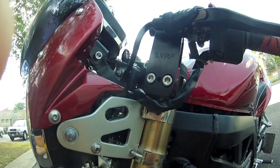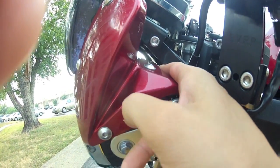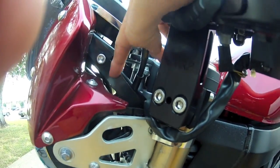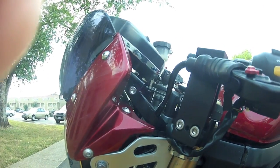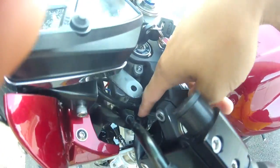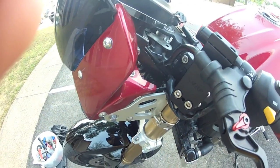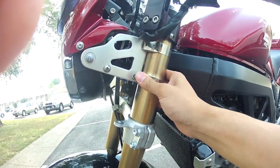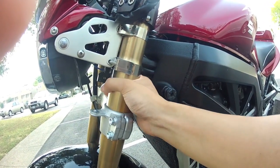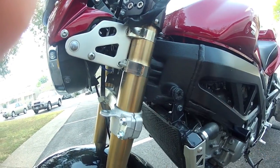For mounting the speedometer, you have one of two choices. You can either drill holes into the front headlamp and mount the speedometer from the back, or you can use what I did — the Aztec 8 speedometer mount, which I'll link in the description. It mounts the speedometer directly to a piece that connects via arms to the ends of the upper T-clamps. You can also buy fork mounts specifically designed for this project from Aztec 8 — they're a little expensive but look really nice. I bought mine for 53mm, which fits the bottom diameter, but I actually needed it for the taper diameter, which is 48mm, so plan accordingly.